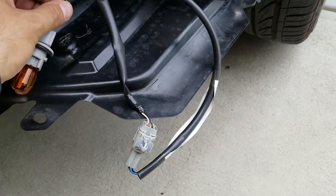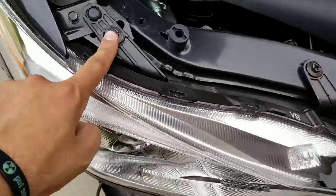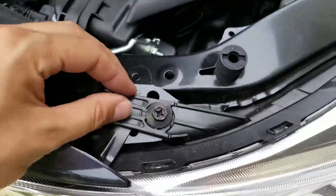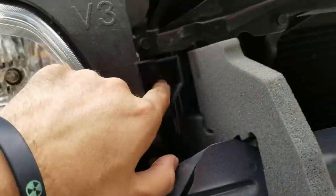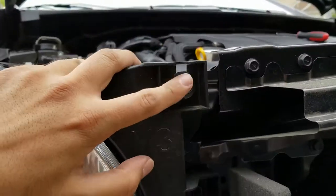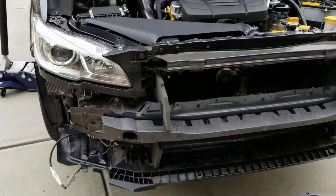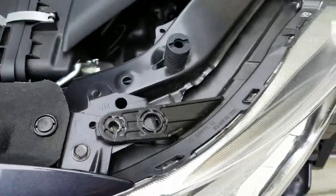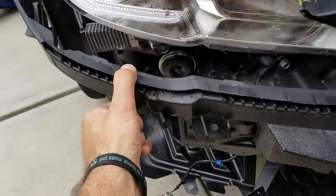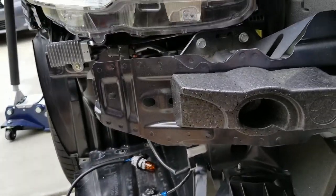For the headlights, it looks like that right there. Not sure if we're gonna have to remove this little clip — maybe. Looks like two bolts right here. I don't see anything underneath, but I do see that one right there and this one right here. I think that'll pop out as soon as we remove that. So you do have to pop this little clip out and this clip out up here in order to continue on. As soon as you do, this whole thing comes off, and pretty much the rest of the screws that I was talking about are the ones you need to remove.